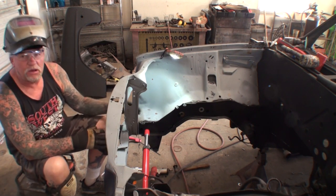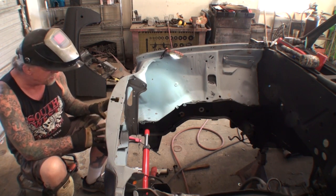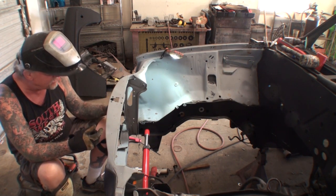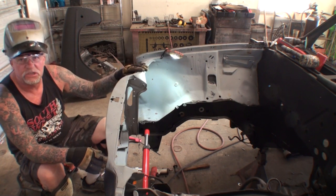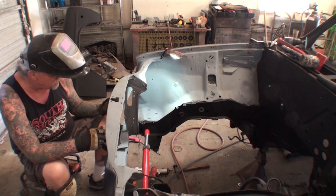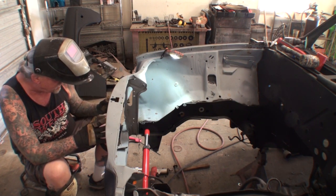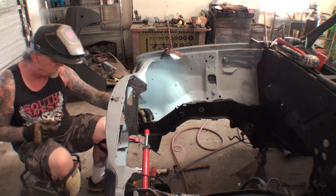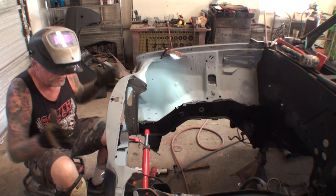And then, once we get everything welded, now I'll come back and grind all the welds down, make it look really pretty for him. The problem you have when you're restoring this and you're using used stuff, alright, first of all, you got to drill all the spot welds out from the original piece that you took off, and then you got to drill all the spot welds out on the piece that you're going to use, and then by the time you put it together, they kind of line up half-assed, but they don't line up perfect. So it makes you go to an extremer type of a weld to get it all to line up properly. So hopefully he'll never get in a wreck with this, because the next person that works on it might have a bit of a challenge getting that tab off of the core support to fix it. But then on the other hand, I don't think he's ever going to drive this car, so go figure.